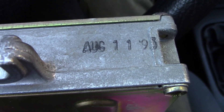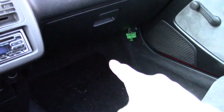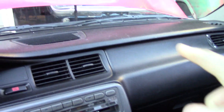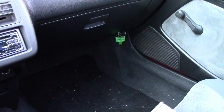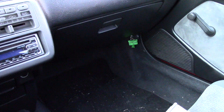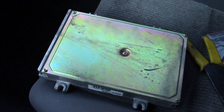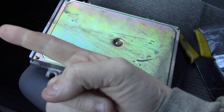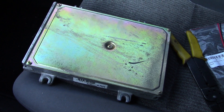This is a manual transmission car and I have zero indicating manual, so let's proceed. Also, this one has a date stamp — August 11, 1993 — that's kind of cool, this is a '93 Civic. First thing I'm going to do is put the new ECU in and make sure the car is going to run with it. I'm going to disconnect the battery first just to be safe with electronics. I've had the unanswered question in my head: will the car run with the P28 ECU and the VTEC not hooked up? I assume yes — it would probably run a lot better because it likely has a more aggressive fuel map to run the slightly bigger intake manifold for the Z6 engine and a better flowing D16 head with a little bigger cam.